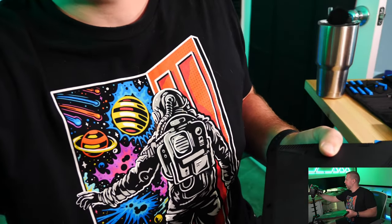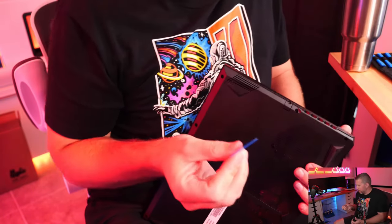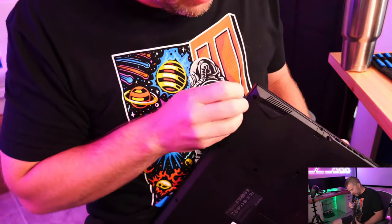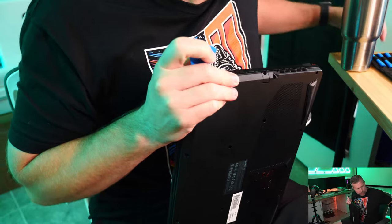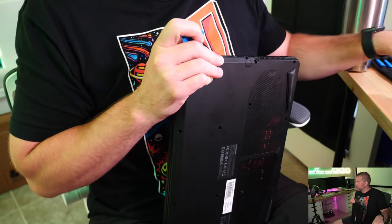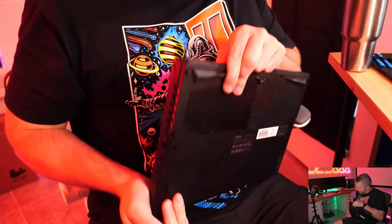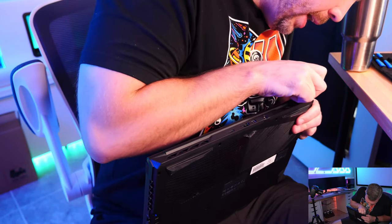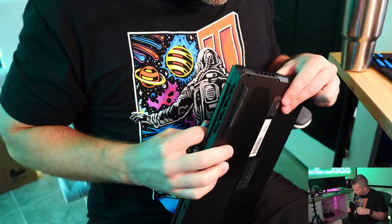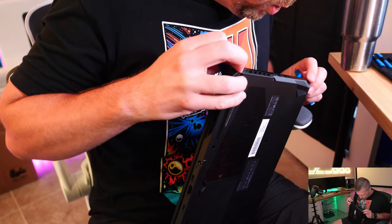Now, we're going to take this bottom panel off. To do that, I need to get it started. I usually use a picking tool here or something to just get into the edge. Sometimes I have to use the separation prying tool, and I do use this iFixit toolkit. There's a link to the toolkit that I use to take laptops apart in the description down below. I do recommend the toolkit. It works really well. So I see a little gap over here. I don't know if I'll be able to get into it or not. Just trying to find a good starting place with these laptop chassis can be difficult sometimes.